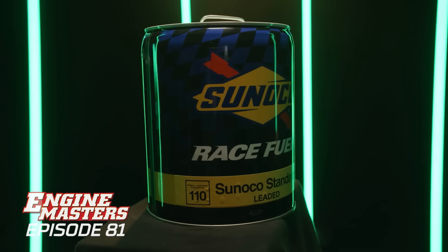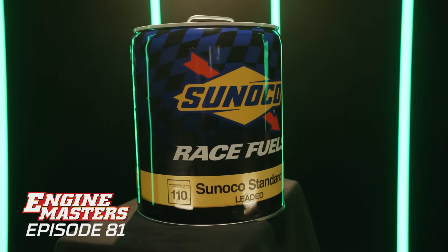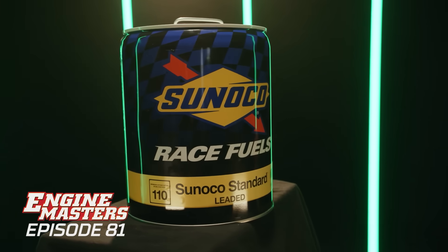Average people go, 'Should I get 87 or get more power out of the 91?' Some gas is advertised as 'superpower 91' or whatever. The fact is, at the pump, if your engine's not in detonation at 87 octane, it's not going to make more power at 91 octane. Is that a fair categoric statement? I think that's a pretty fair statement across the board — if it doesn't need the octane, it doesn't need the octane. Now we're going to go to the Sunoco 110 octane leaded race fuel.